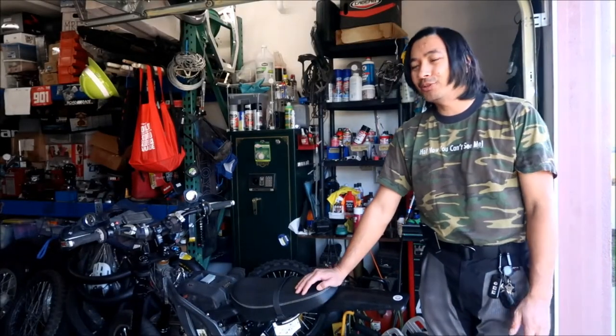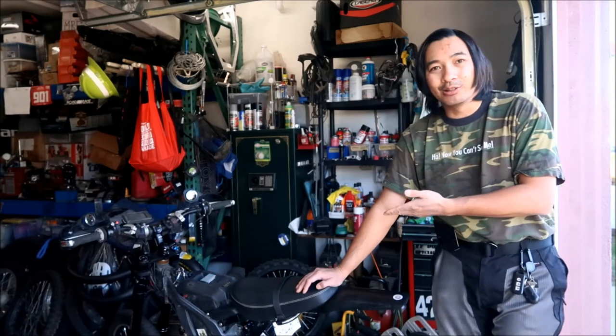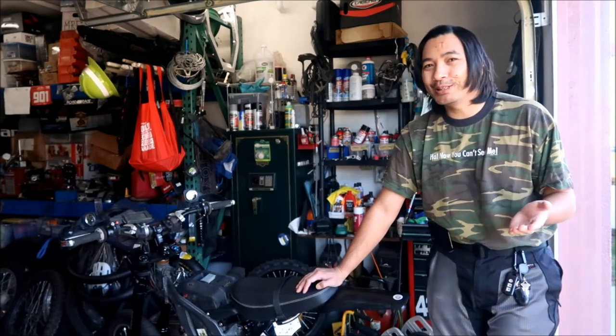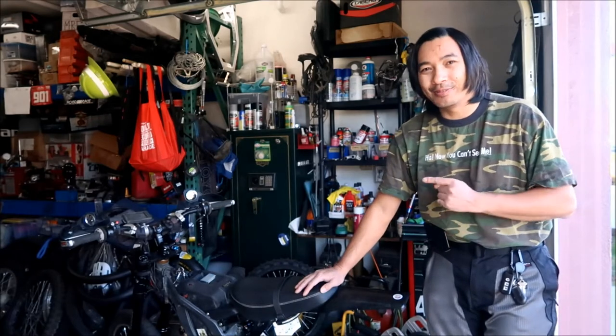All right, it's me here. I took the bike out for a shakedown ride yesterday. I'll put a link at the end of the video on how to set the sag for the Dorado fork on this bike. One of the things I noted yesterday was the suspension is too soft — the rear is pretty stiff but the front is like too soft, so I got a really big imbalance. What I can do is stiffen up the front.